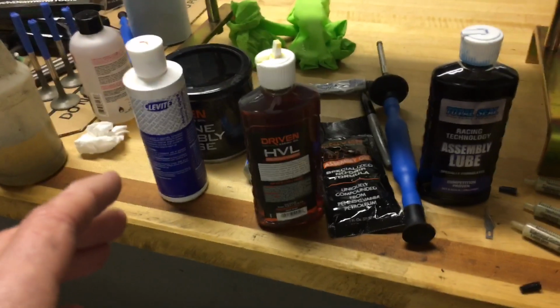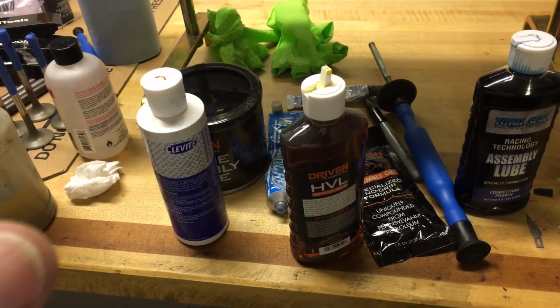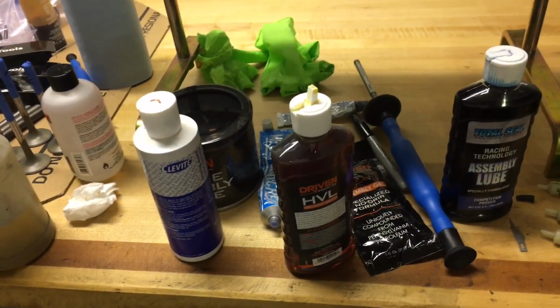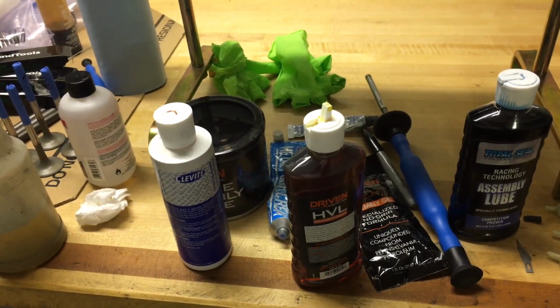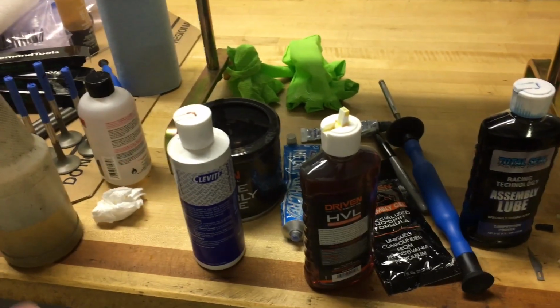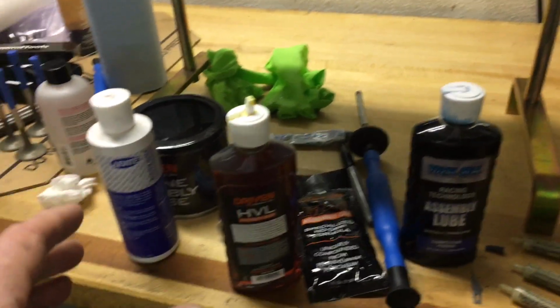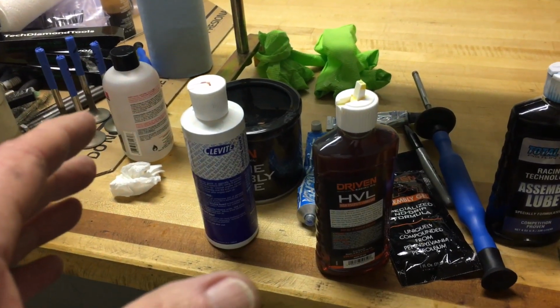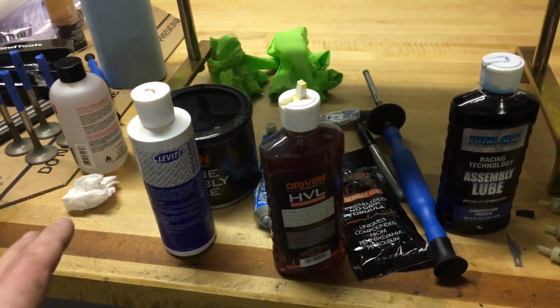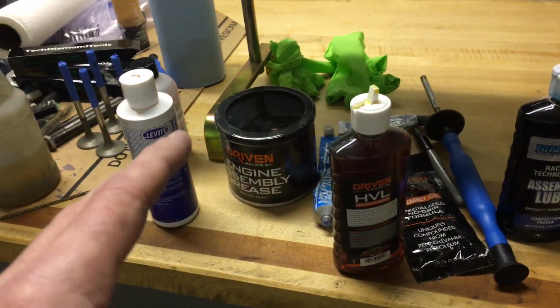The other thing was with regard to the different assembly lube products. I don't want to go into a big thing about zinc additives and moly disulfide and all those kinds of things. There's plenty of videos on YouTube already from Total Seal or Driven Racing products that cover all that stuff far better than I can do here. But the short thing I want to say is that I'm going to use break-in oil on the motor to help the rings seat, and it was important to me to make sure that the assembly lube products I use on the motor don't interfere from a chemical standpoint with my Lucas break-in oil.